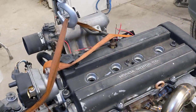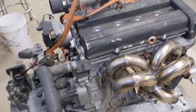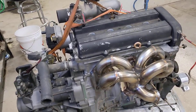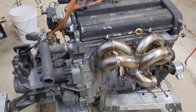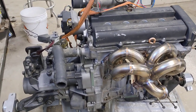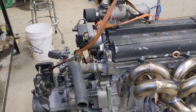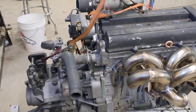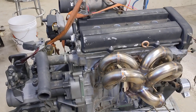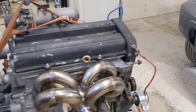With that being said, we had to remove the wire harness off the motor and use the wire harness from the CRV side of it, which then made it so the distributor didn't plug in. Got that swapped over, replaced the o-ring so it wasn't leaking like a sieve, and replaced the thermostat gasket as well as the thermostat — that one was leaking because it got pinched and just didn't make a good seal the first time it was installed.